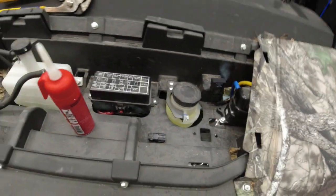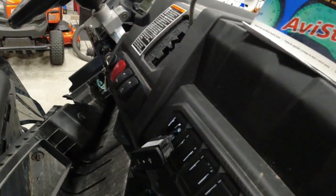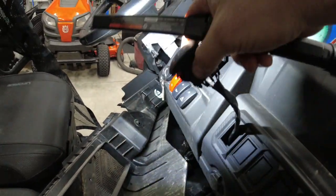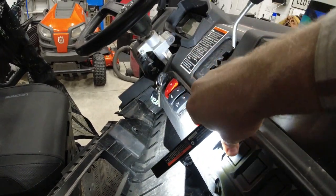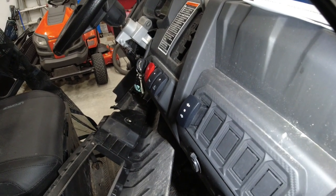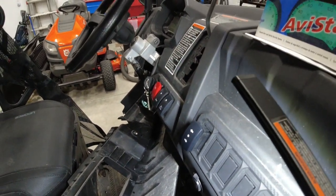So, flasher is in. Moving to the inside, I cut out the opening. See if I can get a light on it, because I know that lighting is bad. Opening is cut out, and I just have the turn signal switch pushed through, and it's sitting there. Don't click it in yet, because inevitably if you click it in, you'll have it clicked in upside down, and your left will be your right will be your left, and then you've got to fight to try and get that switch back out, because they don't come out as easy as they go in.